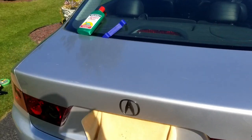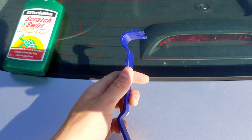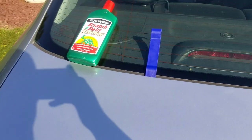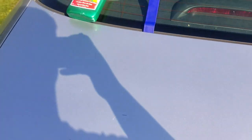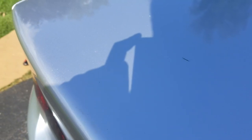I was able to remove all the 3M tape. I first was scraping it off with a plastic scraper, and then later went over with some polish — it's sort of also a scratch remover, so you've got to be careful not to wreck your clear coat. There's no residue left over and it looks nice and clean.